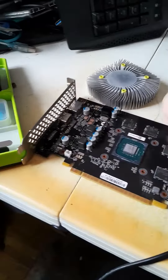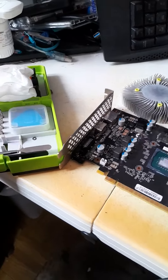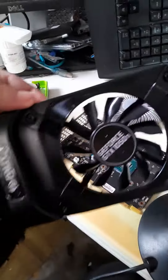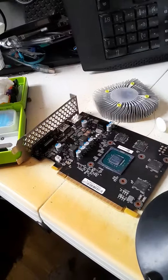I'm going to put some more thermal paste on — you get your thermal paste, put it on, lay it all out, then put the heat sink on. On this particular model it's this one. I'm just going to clean it all up — I'll see you in the next video, give me a minute.